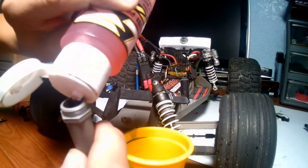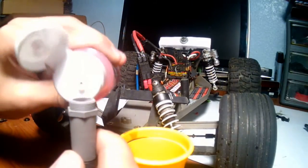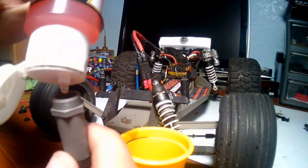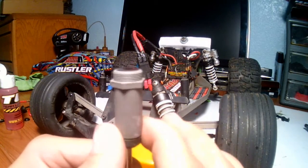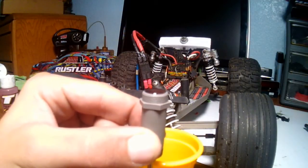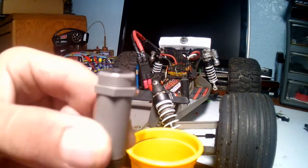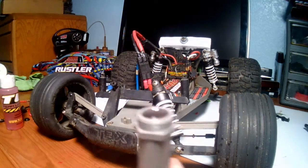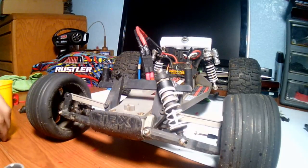Mine is almost to the top — add a little bit more. It's better to overfill than to underfill. Get the bottom piece and push up slowly so you don't spill the oil, then pull down. Now you can tell it's not leaking. Put the shock cap back on — don't forget about the rubber gasket.